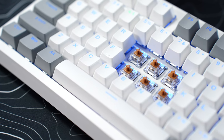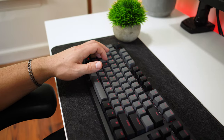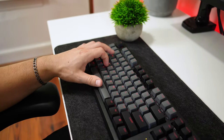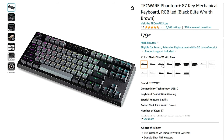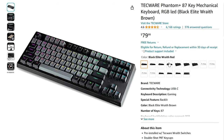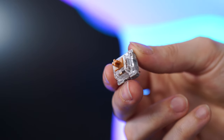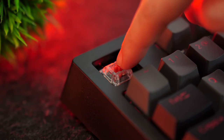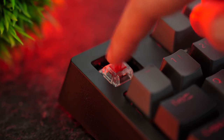The switches here are very impressive, and this is how TechWare achieves that affordable price point. Honestly they should increase the price — you could sell this for $120 and it would still be very worth it. These are TechWare's own switches: Wraith Brown or Orange (tactiles), or Red or Pink (linears). All come pre-lubed. The linears are very smooth overall with some scratchiness — not grainy like a Kailh Speed Silver, more of a very fine scratchiness that could probably be eliminated by hand lubing the switches yourself.